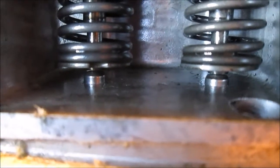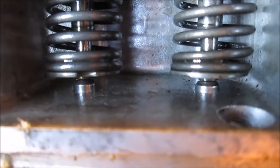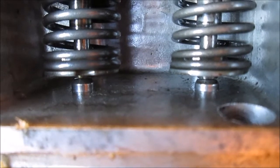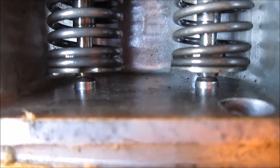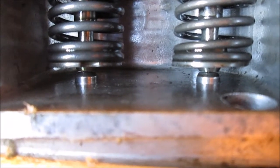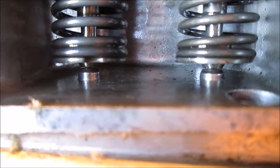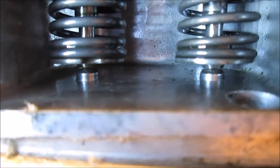What we're going to do — because we're going to lap these valves, even though they look good — we're going to grind the end with our diamond disc. It's like a disc sander with a diamond wheel. We're going to have it set up 90 degrees with the blade so it's all even. We're going to pull the side cover, pull the cam, pull the tappets out of here.